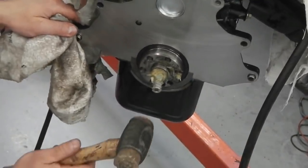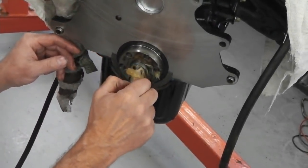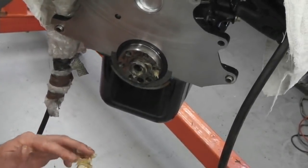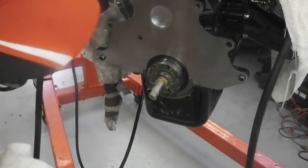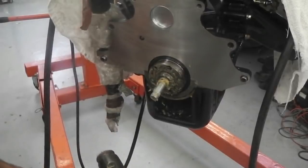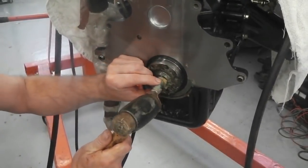So I'm just going to strike that. Bottom out on the end. And there's the spigot, almost ready to take out. A couple more hits, I reckon, and we'll have it. Let's see if we can do it while you're on. Okay, we're nearly out. What I found worked best was fast blows. Seems to get it. Let's just check you're still on. I'm going to flip the screen. Yep, you're still on. Yeah, fast blows tend to be the one. If you tap it slow, you don't seem to get anywhere.